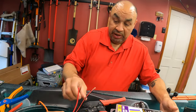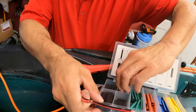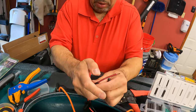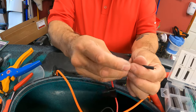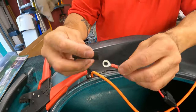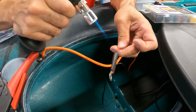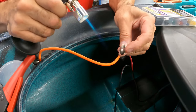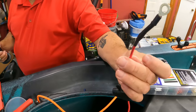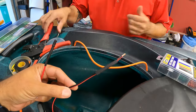Right now what I'm doing is splicing these wires and putting some shrink tubing on the connector so we have a nice watertight seal once the connector is on. Just in case water does intrude, I don't have to worry about any water getting into the electrical part. So we're done with splicing and cutting — just run wires, drill holes, and we're pretty much done.